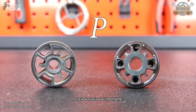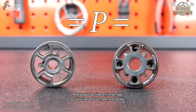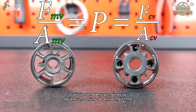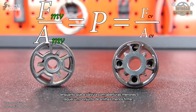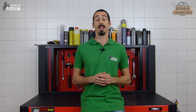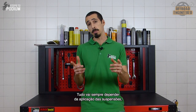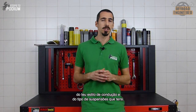Why is this important? Well, the chamber between both valves will be under the same pressure, so if you want them to open at the same pressure, the valve with larger ports will require a stiffer shim stack, and the valve with smaller ports will require a softer shim stack. At the end of the day, the possibilities of tuning your suspensions are endless and will always depend on what they are for, your riding style, and the kind of suspensions you have.